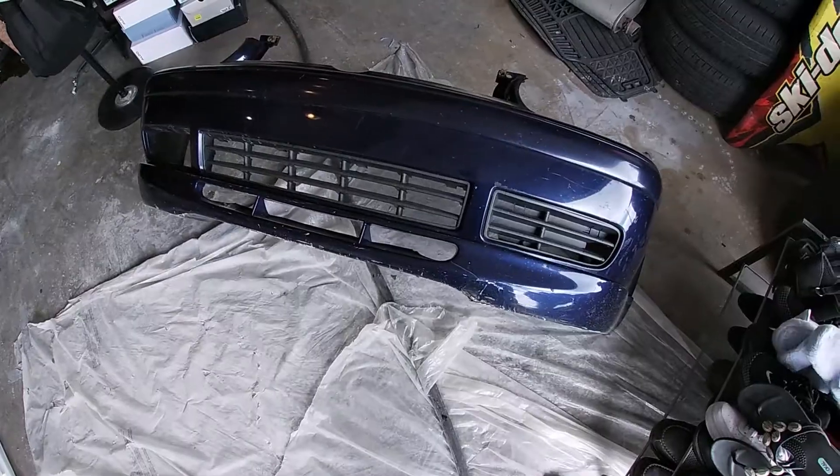I'm going to do a little time lapse — actually, I just like to get things done. I'm going to take off the rest of the bolts on the shield, take the splash shield and fender liner bolts out, and that should free up the front bumper. Get this thing off, get the headlights swapped out, and go for a rip. I'll pick the camera back up as soon as the bumper is off and disconnected.